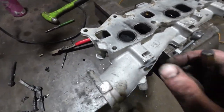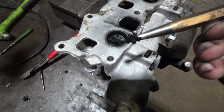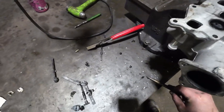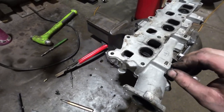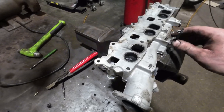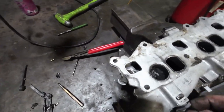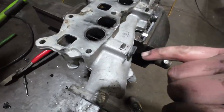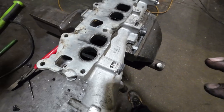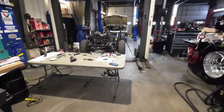Here's one of the reasons why it's beneficial to remove these intake swirl valves - look at all that carbon buildup. All that buildup comes from the EGR system, which is also why I'm going to be removing that system. This is one of the main things that ails a 3 liter Mercedes diesel - these valves get all coked up with carbon, then they seize up and the little linkages break. It goes into limp mode because half the time they get stuck closed and one whole valve is not getting airflow. So I am physically removing the flap and plugging the hole, and we're going to be removing the EGR system from this engine. We will no longer have carbon buildup and we'll keep the engine clean and running better.